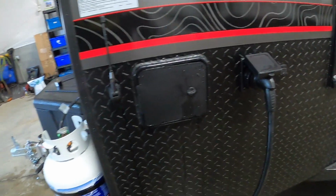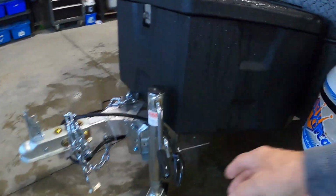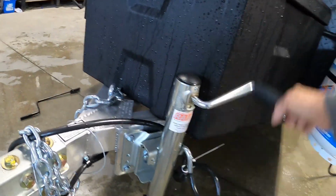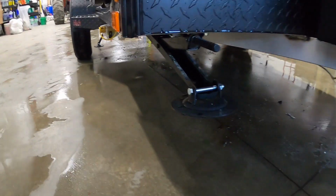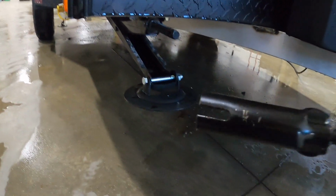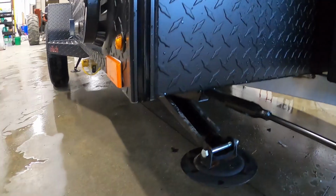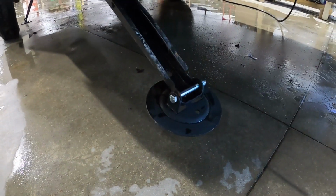Alright, you got your power and water hooked up. Just go ahead and get the unit level. Hand crank on the front will bring this up and down until you're level. Once you are level, you're going to put down our stabilizing jacks. All four corners got these stabilizing jacks. Got this little hand crank with this notch in it. Line that notch up with the groove in here and run these down. Now, we'll recommend stabilizing jack pads.